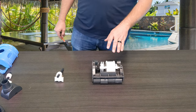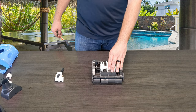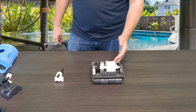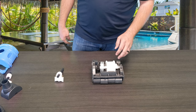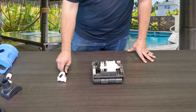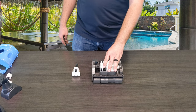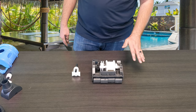We want to show you guys how to get access to this actual center oscillator turbine. Over time, this will start to warp and wobble as the suction side is constantly pushing on it, whether or not it's had debris stuck in it. They tend to be the most replaced items aside from the actual left drive kit. This is your second most replaced part because of the abuse it takes from the pump itself and just the actual functionality of the cleaner.